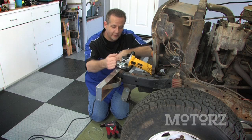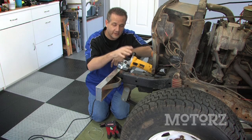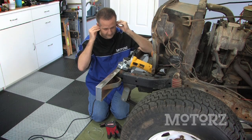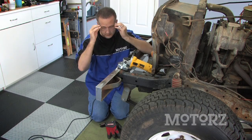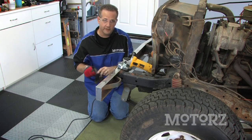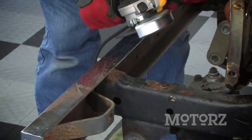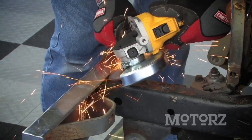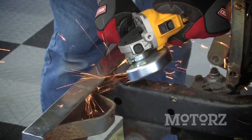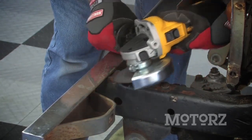There are many different ways to cut off a bumper that's been welded onto your frame. We're going to go with this DeWalt angle grinder with a four-and-a-half-inch cutting wheel. But before you get started, you need to make sure that you've got all your proper safety equipment on, which includes some earplugs — because this will get quite loud — as well as your safety goggles and of course some gloves. When you're cutting that weld, make sure you just apply a moderate amount of pressure. Like butter.